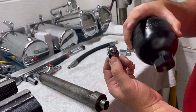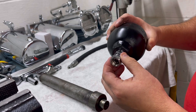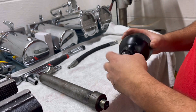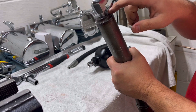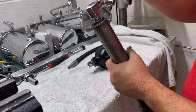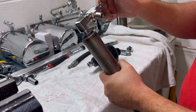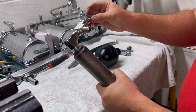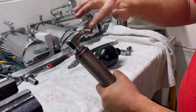You've got your accumulator right here — it's a half-inch port on this one in particular. The fitting has an O-ring down towards the bottom and it seals through pressure, with an O-ring on the inside. It is also a swivel fitting. On this particular cylinder it is a 3/8 port — it's a male to a female, a 90-degree male-female — and then you've got a T-fitting that has male-male-female, and then your 3/8 fitting that goes in here, if you're running 3/8 lines.